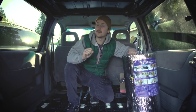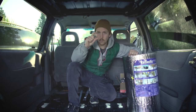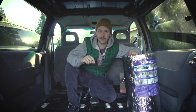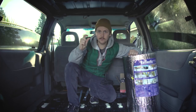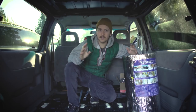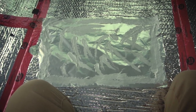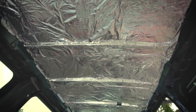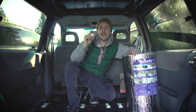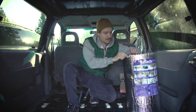Another instance where you can really use reflectix well is on the ceiling. I have a one-inch gap between the metal studs built into this minivan. I'm using half-inch rigid foam, then I'm doing a radiant lining — a type of radiant material like reflectix but super thin — attached to the rigid foam. You can get rigid foam that already has that lining, but I didn't, so I'm putting it on after the fact. That leaves just under half an inch of air before I put the reflectix on.